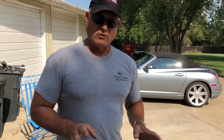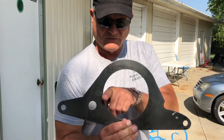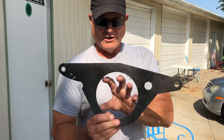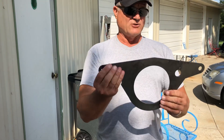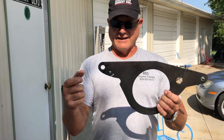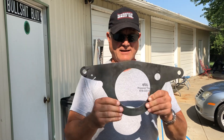What we thought was a torque converter issue was actually a misalignment. Our adapter plate on the back of the engine had dowel pins that were not perfectly lined up — one was off 4 or 5 thousandths and the other was almost 18 thousandths. So we were shoving sideways on the torque converter snout on the transmission, and it knocked the pump out of the transmission twice. Thunder V12 provided us with a nice alignment gauge that goes around the crankshaft adapter off the back of the crankshaft. We got some offset dowel pins, lengthened them, put them in, lined them up with the alignment gauge, welded them from the back side, and that was the end of our transmission problem.